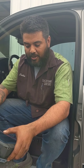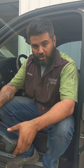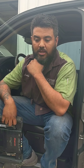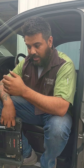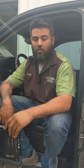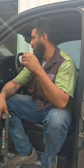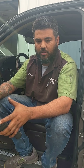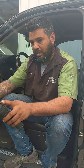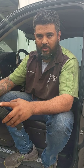This is Carlos here with Backyard Diesels, here to help you out on your Duramax. This is a 2013 LML. We got this truck going in limp mode. We have reductant quality pressure code P204B popping up. What that means is there's not pressure in the DEF system — the system's not holding pressure.